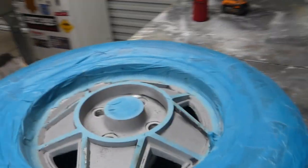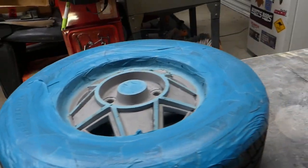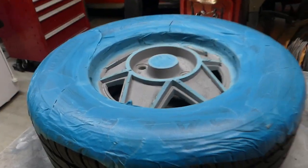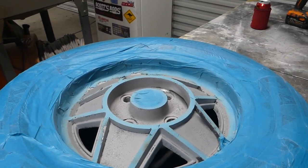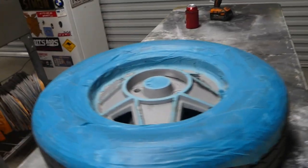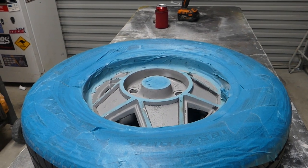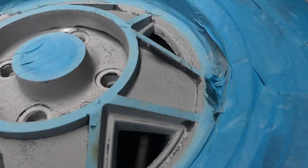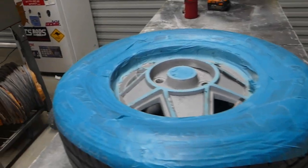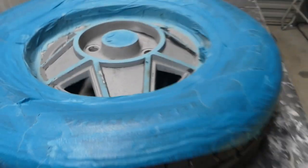It's going to have to be paint stripper, and I'm going to try that next to see how effective that is. I did read you have to be careful with paint stripper, and being aluminium, it needs an etch primer, but I've got some epoxy left that I want to use. I'm going to get some paint stripper for those odd bits that are lingering in the corners, etc. The sandblaster just couldn't get into them, and I didn't want to hang around with a sandblaster too long.